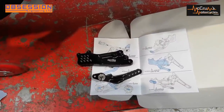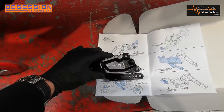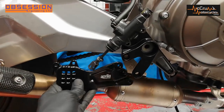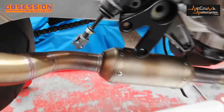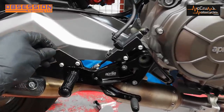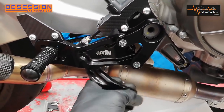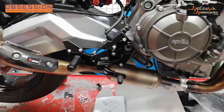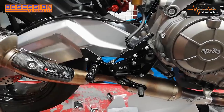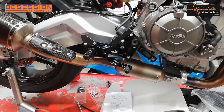It's time to build the rest of the rear sets. On the brake side, the brake lever bolts to the hole behind here, the whole thing bolts onto the back, and then there are loads of positions I can put the foot rest so hopefully everything will work and look very racy. The brake side rear set is all fitted and with its little carbon fibre protectors and heel guards they are nicely machined — a very nice piece of kit. The retail on these is £720 for a set but they are lovely. I've put them right in the middle of their adjustment range so when our special rider arrives we have options to move everything.